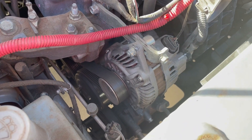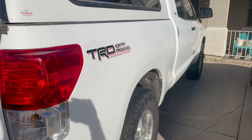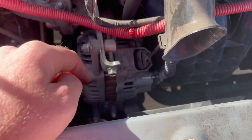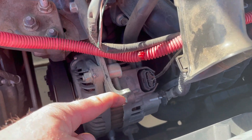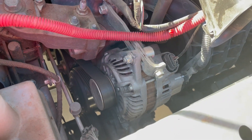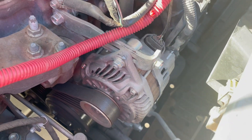I love it when auto manufacturers put the alternator right here on top — makes it so easy. That truck right there, the alternator is on the bottom of the engine and it's a pain to get on and off. This one should be pretty easy. Looks like we got the power coming off of it right there, the plug here, and if we just loosen this nut we have a slide to loosen the belt — that must be your tensioner right there. I'm thinking this thing's going to come off pretty easy, but you know how that goes when you're four hours into a 30-minute project.